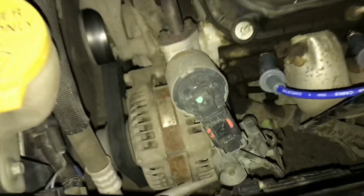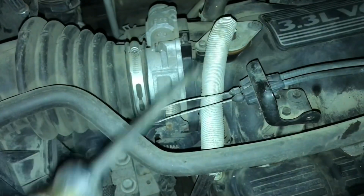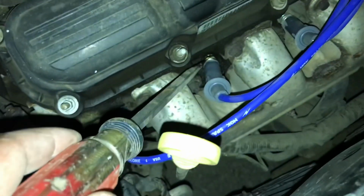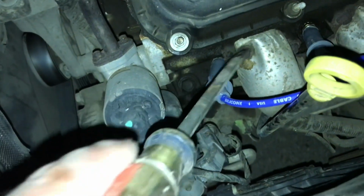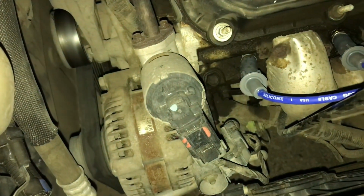So anyways, because this is your EGR valve, exhaust gas recirculation. So this goes up to your intake. And vacuum opens, closes, whatever, and it draws exhaust gas this way into here, which is your exhaust port. And you see how much space there is here. This is missing that because of this port here. So I could see number two on a lot of these minivans having a short on it just over time.